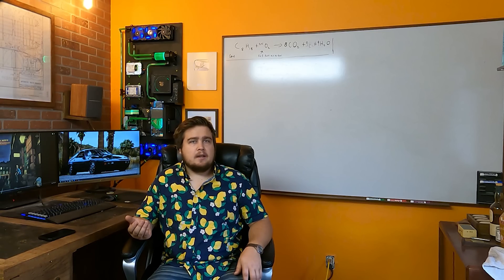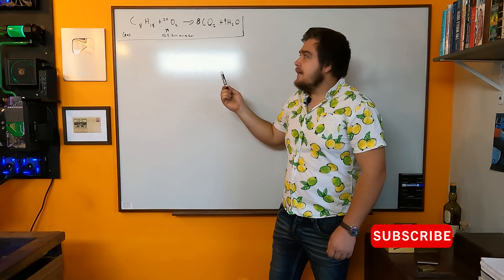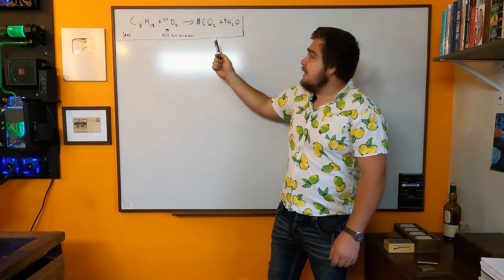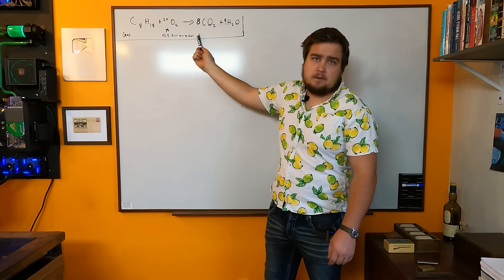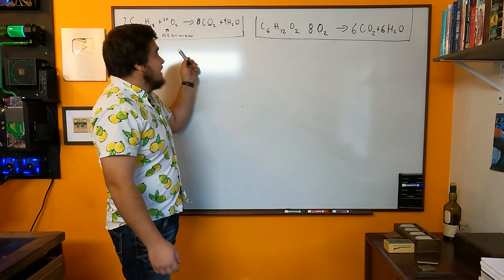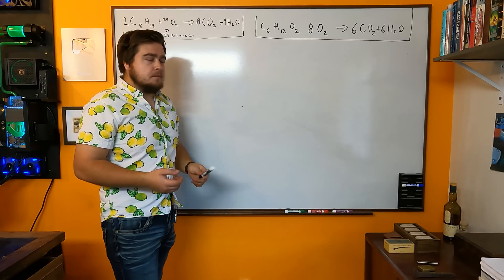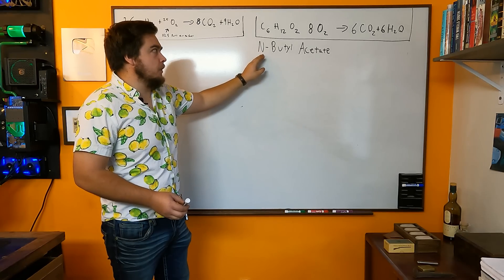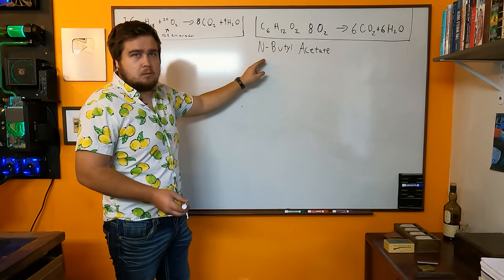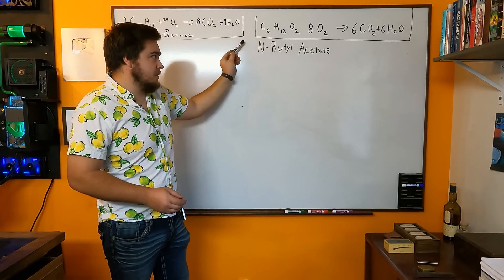While that's cooling down out there, and before we drain gasoline, let's take a look at what we're actually talking about here. So, to start off, we're talking about gasoline. When gasoline burns, it needs gasoline, it needs oxygen, and then it makes CO2 and H2O. In fact, it needs 12 and a half parts air to one part fuel. What we're looking at today is called N-butyl acetate. If we balance out the burning of butyl acetate in the same way, we see we get eight parts air to one part fuel — so it's actually fairly close. Because N-butyl acetate is an isomer, there are a few other butyl acetates with the same structure but arranged differently — namely, tert-butyl acetate and isobutyl acetate. For this video, I'll refer to it as butyl acetate, but it's just N-butyl acetate.